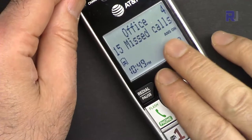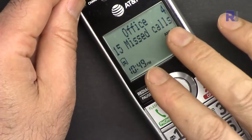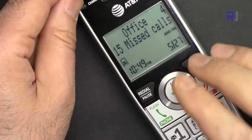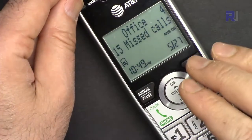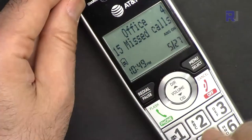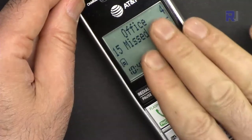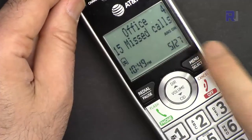Home area code is to identify local calls from long distance calls. This will apply and work only in an area where you enter only 7 digits. In US and Canada, we enter only 7 digits to make local calls. But if we enter the area code, which is usually 3 digits, then it will be 10 digits. In some cities or areas, people enter 10 digits in every call that they make. For that purpose, it doesn't work and it doesn't matter. But in case you want to set the home area code, here is how you do it.